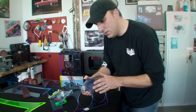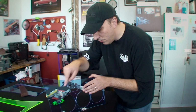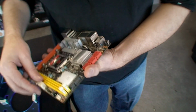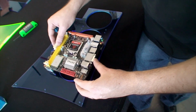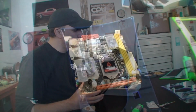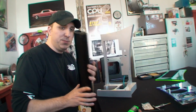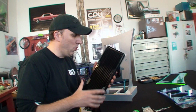This is the side of the PC that's going to hold our motherboard, and these are the standoffs that we made for the little Zotac ITX motherboard, milled from aluminum. Just out of respect to our sponsor Zotac, when the motherboard's mounted, we're going to flip their label so you can actually read it the right way. The radiator we chose is a Hardware Labs Black Ice GT Stealth Gen 2. I like these because they're thinner than most radiators, so it allows you more space to work with.